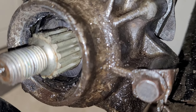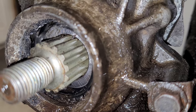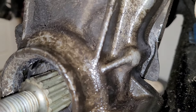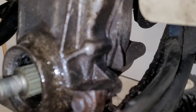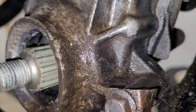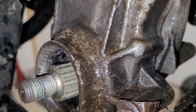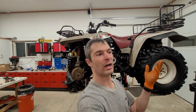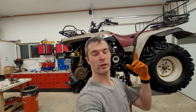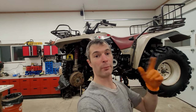I've been picking away at this seal for about 10 minutes and it's probably hard to tell, but this seal does not come out from this end — it actually comes out from the backside, which means I have to remove this whole gearbox. And in order to remove the gearbox, I have to remove the swingarm and a few other things. I really thought I could just pull it out the way it is and plop it back in. So I still have to remove the rear axle, the whole subframe, swingarm, and open up the gear case to even get to the seal. I'm going to make this a two-part video.